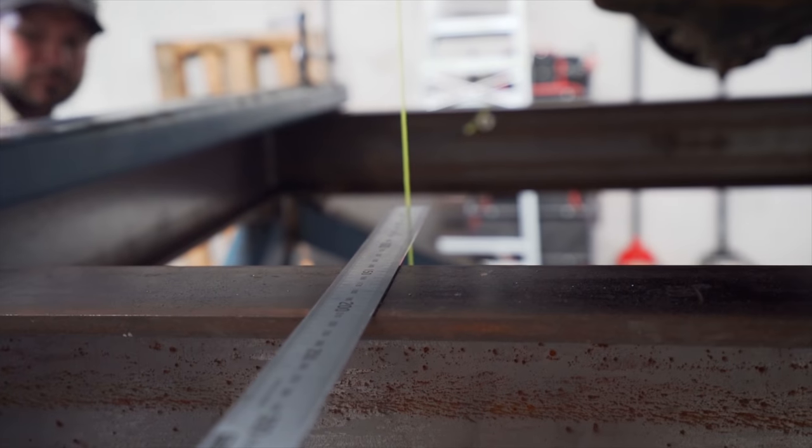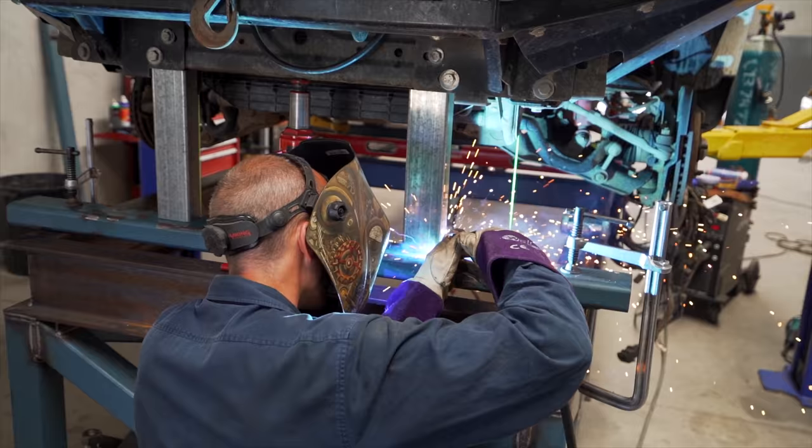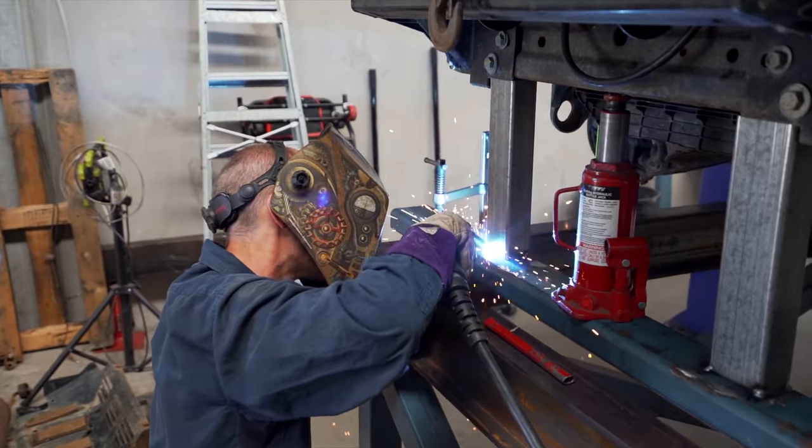I suppose there's a couple of us in the country that do it on a jig, and a lot of guys who just cut cars on axle stands. I learned cutting cars on axle stands, and it is hard work trying to keep it square. It moves, it shakes, and you don't feel very safe under there. So we built a big jig, weighs about 700-800 kilos. It's fully adjustable, up and down, left and right, forwards and backwards. But basically it holds the car dead square.